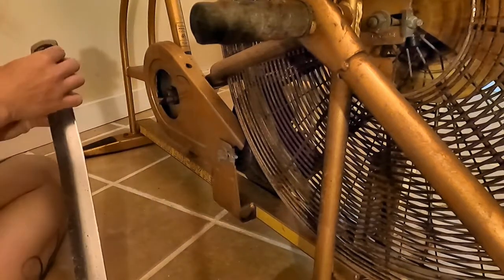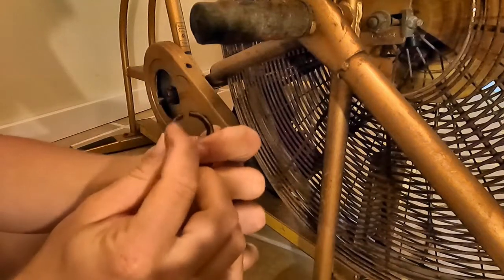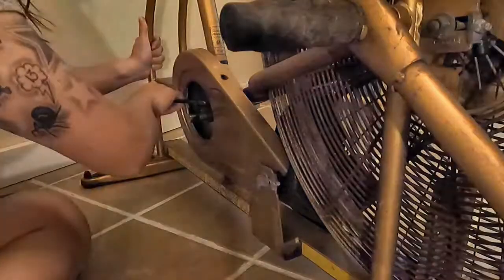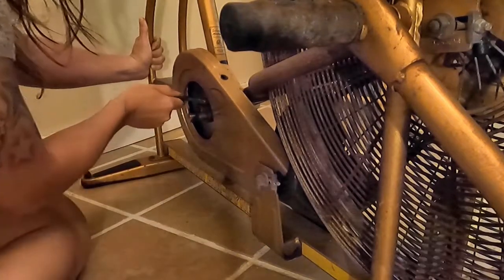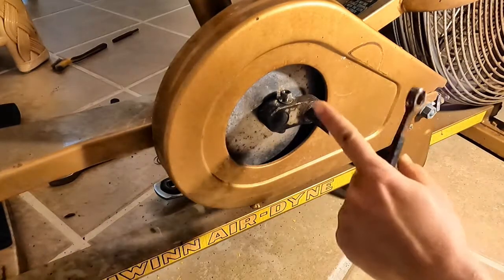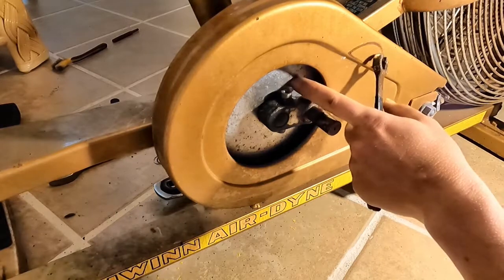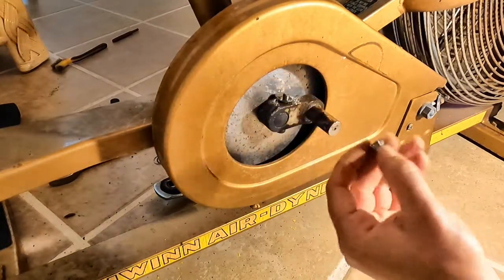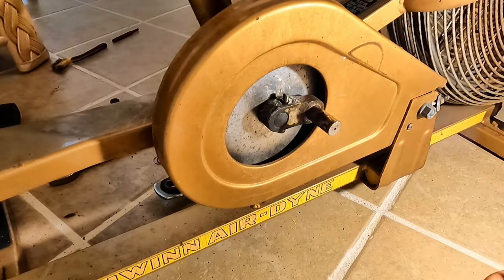Connecting arm comes off. There's only, I think, one nylon washer on this one, and it just fell apart. And it's split open. Definitely need to replace that. I do not have the right tool for this. It's a common theme. Okay, this nut here, you'll probably need a socket on a 1/4 inch drive or a regular open-ended wrench, not a line wrench like what I've got. It's too close to the sprocket to be able to turn. So I cheated. Don't be like me. But when I go back to reassembly, I will do the right thing and go get the proper tool.